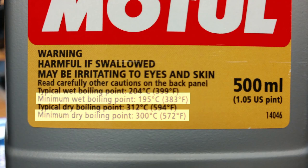The measure of how good a brake fluid is comes down to its boiling points. Brake fluid has two primary measures: a dry boiling point and a wet boiling point. The dry boiling point applies when the fluid is new. By its nature, brake fluid is hydrophilic — it attracts and absorbs water over time. Water doesn't have as high a boiling point as pure brake fluid, so the mixture ends up with a lower boiling point. A fully saturated brake fluid will have a lower boiling point, and that is the quoted wet boiling point you'll see on most high-performance brake fluids.